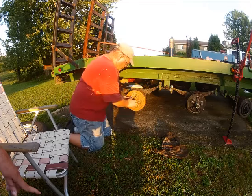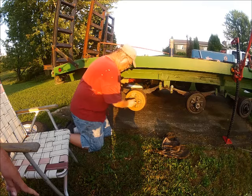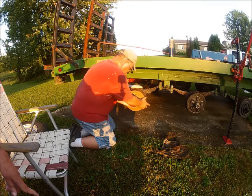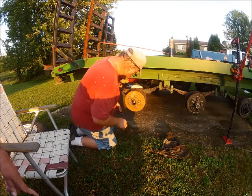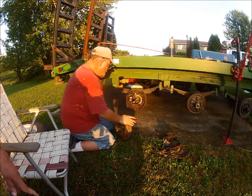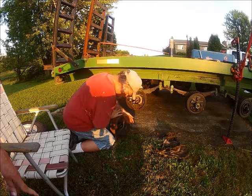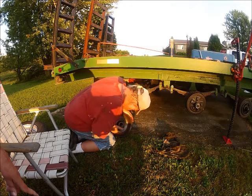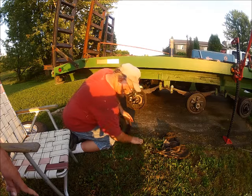First I'll take it off and check inside, make sure there's plenty of grease — and this seems to have lots of grease. The washer, the outer bearing — yeah, there's lots of grease in there. The seal's not leaking. It's good and dry in here. Still got good brake shoe, still got good drum, no marks on the drum. The seal's in place, and there's lots of good grease in here. So this one's in fine shape, ready to go back together.